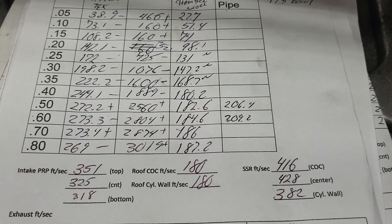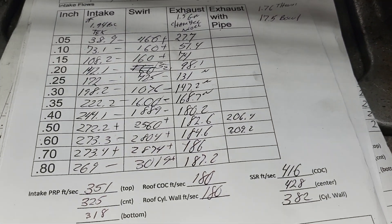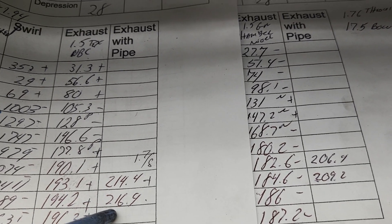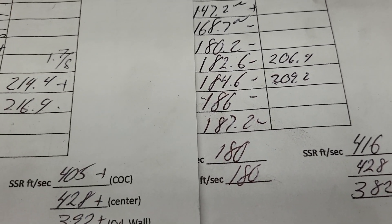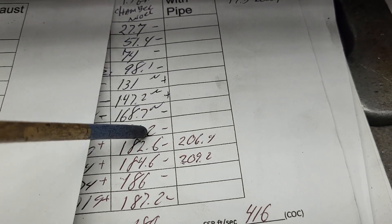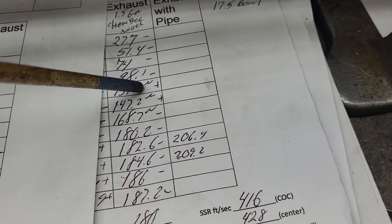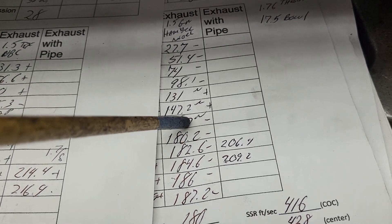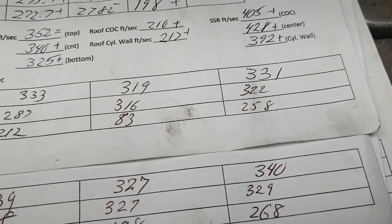As far as our short side - 416, 428, 382 - not quite as good as it was with the bigger valve. It'll be interesting after I change it to a bigger valve to see how this winds up. Let's take a look at our exhaust. This looks like a major failure - I do remember we had that exhaust really cranking at like 216. I reshaped that chamber to fix some noise there was in this area. We got minus, minus, minus - we got less noise in fewer spots, only three spots now versus five spots before, and we got two pluses. But the rest of the whole port is down more and we max out a few CFM less.